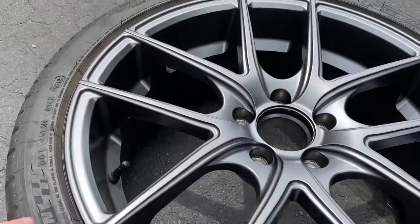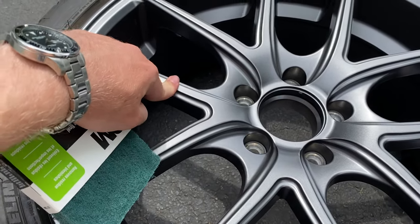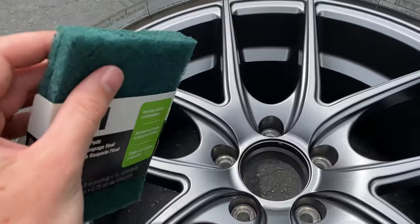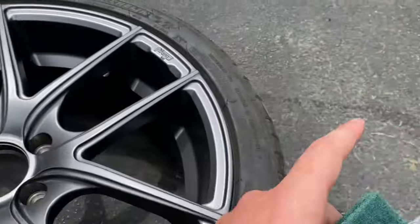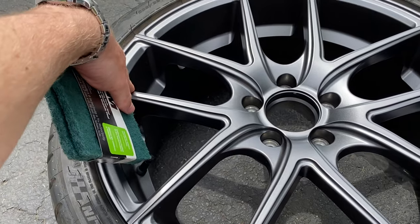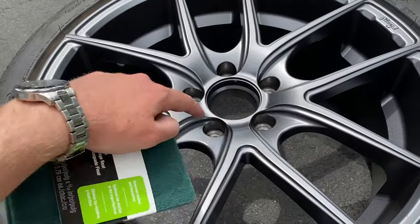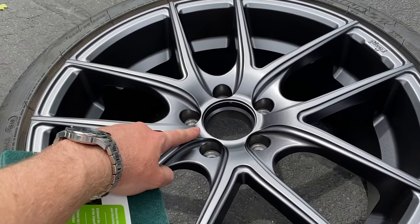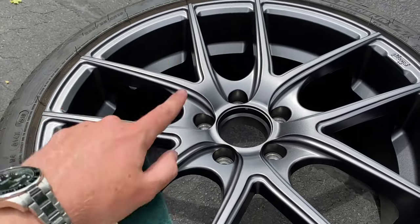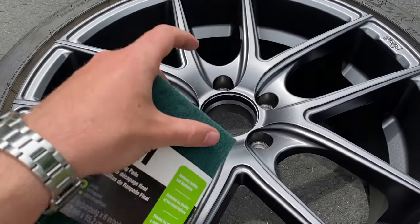Speaking of the metal — this is painted on from the wheel company, so I'm not priming it. It's not bare metal. What I'm going to do is just scuff this up with the 3M pad, and that'll make sure it's plenty ready for the paint directly. But before we even do that, I know this wheel is brand new, but I still want to get it completely washed down. There's some dust that has gotten there over the last couple of days. I might use dish soap just because that's more of a degreaser — normally you don't want to use dish soap on anything car related, but this could be an exception since we're prepping for paint.